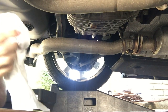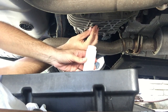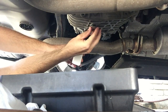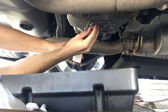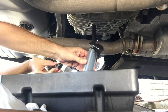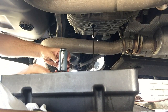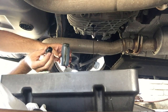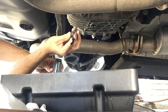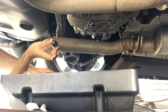I've got a rag at the ready. I'm holding this drain plug in as I turn it — I don't want it to fall. I want to allow some of the fluid to drain out at the bottom, then I'm going to get my sample from the middle of the fluid drain. All the threads are loose, I'm going to pull the plug. It is pitch black. There's quite a bit of sludge on the tip of this too. I don't think that's unhealthy — I'm sure it's normal to have some metal filings, especially from the initial fluid from the factory.